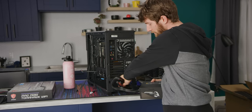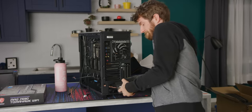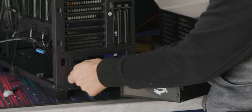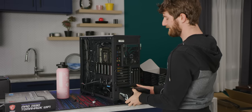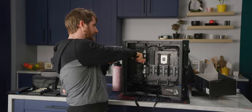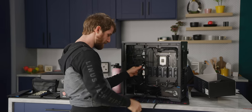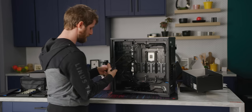I'm gonna have my fan down and gently put all these through — and then realize that I have screwed up and needed to take the back bracket off first. With the power supply installed, all that remains is to run our cables to where they will ultimately live. Our 24-pin ATX goes around there, and our SATA connectors go down in the bottom.